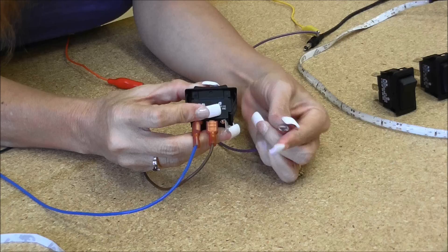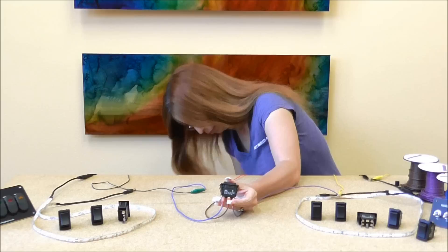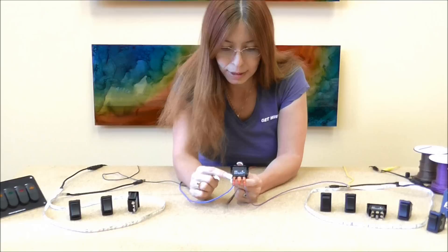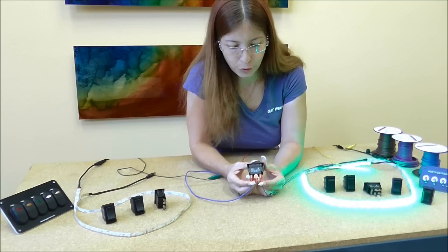This is a really cool switch. I'm going to hook up the accessory on the other side — just push them on. Push-on terminals, push them on. It's in the off position right now. I'm going to give it juice and then turn it on. Remember, this is accessory-power-accessory, so when you push the on position on either side it's going to power the opposite terminal.